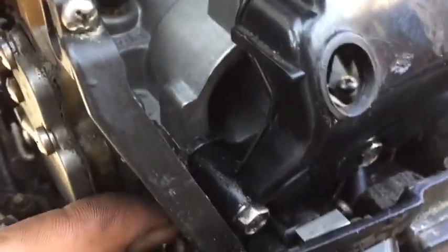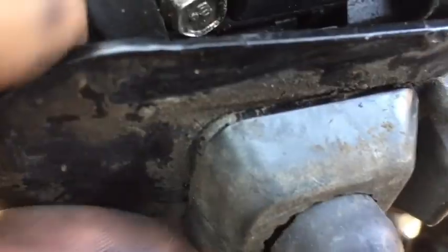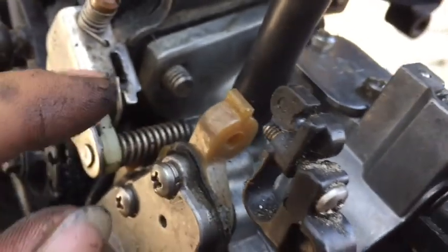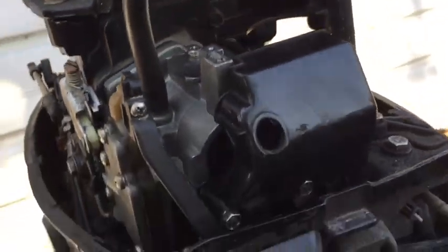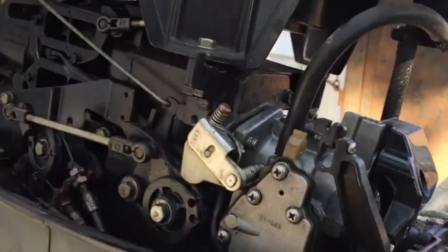I left this piece loose, lifted it up enough to put the two bolts back in and got them tightened up, then got the clip back in to hold that piece on. Now I can put the two nuts on, then put the choke rod back on from there to there, and the engine will be ready to run. Thank you all for watching — please like, subscribe, follow, ask questions, and comment. Anything you want to know, please ask and I'll try to answer it as best I can.